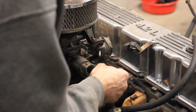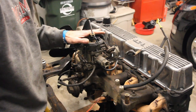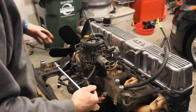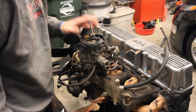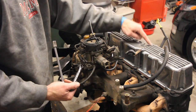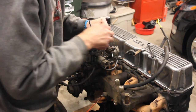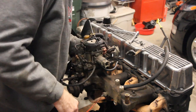This won't take like an hour and a half to get off. I know this is not original — or at least this is, but the air filter isn't. The original air filter looks like the Millennium Falcon — it's this big black thing that comes over here and has an air connector to the front of the Jeep. But once you take that off, which just involves a couple bolts, or you take off your air filter, you can actually get a socket and extended socket into these little areas, which is kind of nice. You can do the back ones with an extended wrench socket.